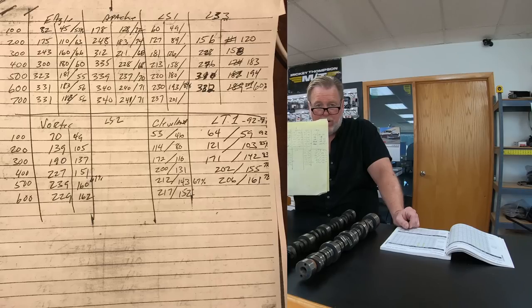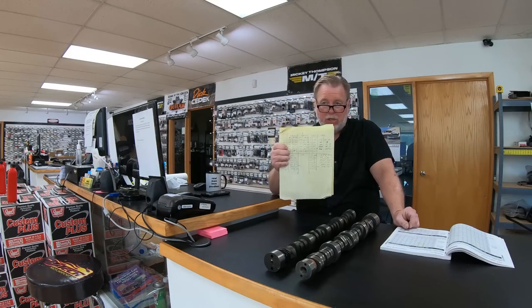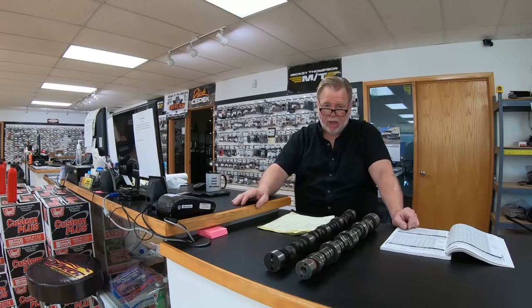The flow numbers and the percentage of flow from intake to exhaust are very important with camshafts. It matters how much duration you put on the different lobes — is it a 224 intake lobe and 230 on the exhaust? That depends on the actual percentage of flow between the two. The LS1 cylinder head at 0.600" lift flows about 230 CFM intake and 193 CFM exhaust — numbers I've measured and verified with other tuners across the country.